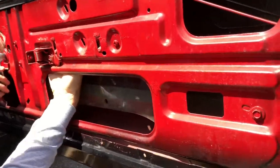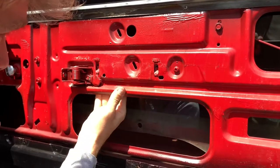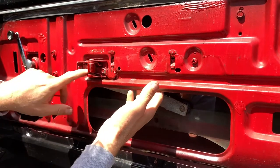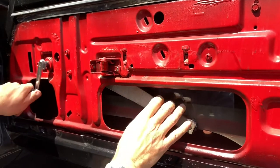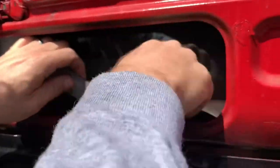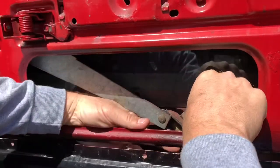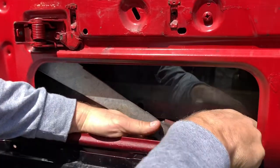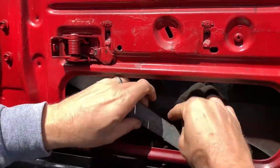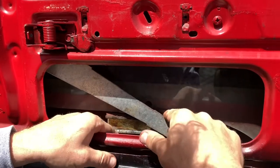If I crank my window down, it's probably going to come down. Be careful that you don't interfere with the wire — there's a wire from where you open the door that goes back there, so make sure you don't mess with that. Crank it down. And here it is. That arm goes in this channel on this side of the window. You can see the window rests there. Coming out from this side is a little easier. I've got the window resting in that one and that one.